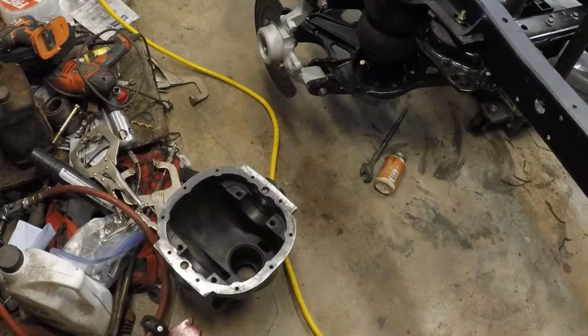So it was a 327, and I was happy with the 327. Could have stood a little taller gear. I thought with a 6-speed, we'd still get good cruise, low cruise RPM. And so I ended up going with a 355 gear posi, and it's on its way. I ordered it a day ago, and it'll be here hopefully midweek next week. That's another 3 or 4 days, and then we'll start putting this thing back together.